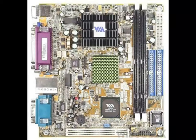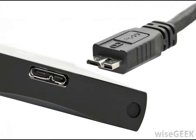For desktop motherboards that don't have an eSATA connector, a Peripheral Component Interconnect card can be purchased and installed in an available PCI slot to provide an eSATA interface. Notebooks can use an external eSATA device made for the PCMCIA PC card, or Express card slot, depending on the laptop model.